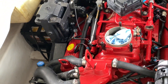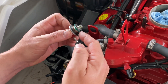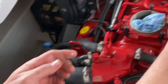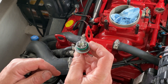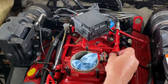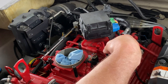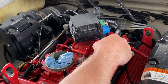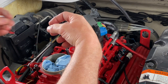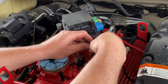Now we're going to reinstall the fuel pressure regulator. I took some motor oil and wiped it lightly around the edge to help it slide in easier. Some of these have screens on them — make sure you clean that off. This one happens to have the E-clip. Put your clip in, then your vacuum line.